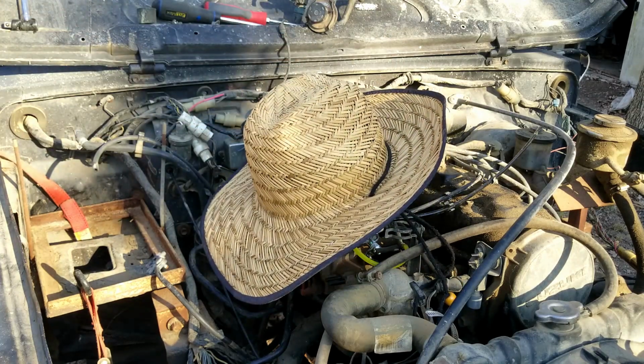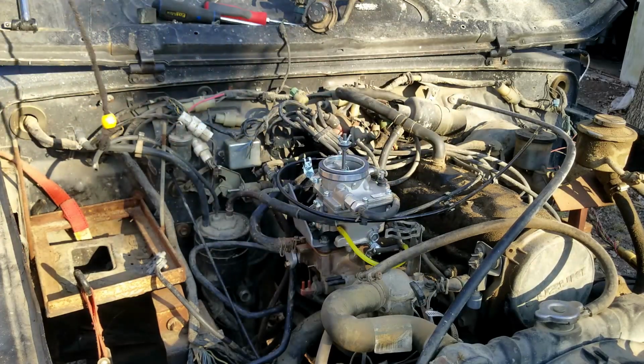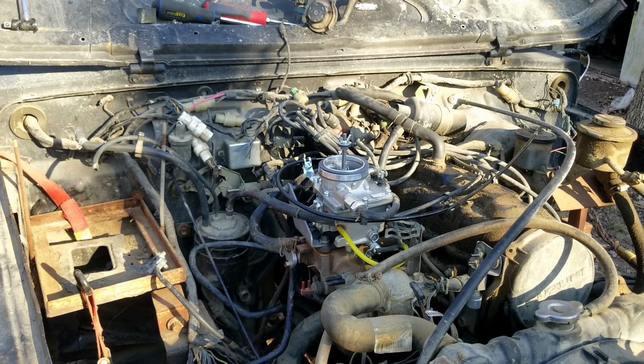With the hat in place, install the second washer gasket onto the stud with the gasket facing down. Top it off with the wing nut. The wing nut should compress the hat onto the gasket under the carb to hold securely. You may need to adjust a nylon nut accordingly to get a good snug fit. And then finally, the rest should be pretty obvious.